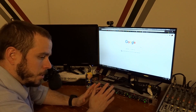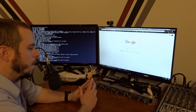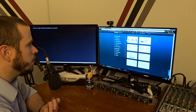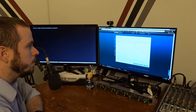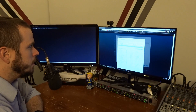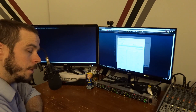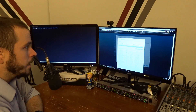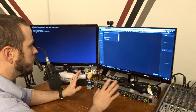Let's get into actually configuring the machine. While this is booting up, let me explain one other thing I did last night. I have a Linksys router for my home router. What this router lets you do with DHCP is set DHCP reservations — you can see I've got DHCP enabled and my allowed range. I've given the FreeNAS box a reservation so it'll always have the same IP address. That's really helpful because that way other computers always know where to find it when they create their connection to it.